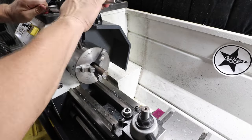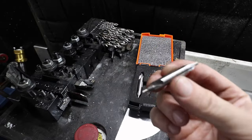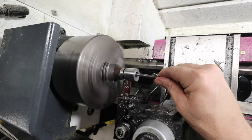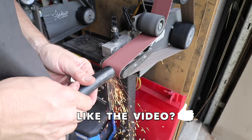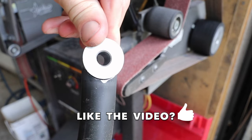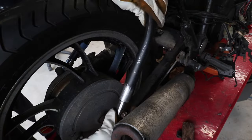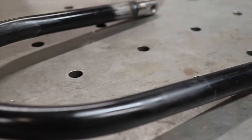The last component I need to make is a steel bush for the bolt to go through, which will be welded to a piece of pipe with a similar curve to the tire, then welded on top of a plate which will be mounted to the top of the swing arm. I went ahead and tacked on the end caps as well as the plates that I made.